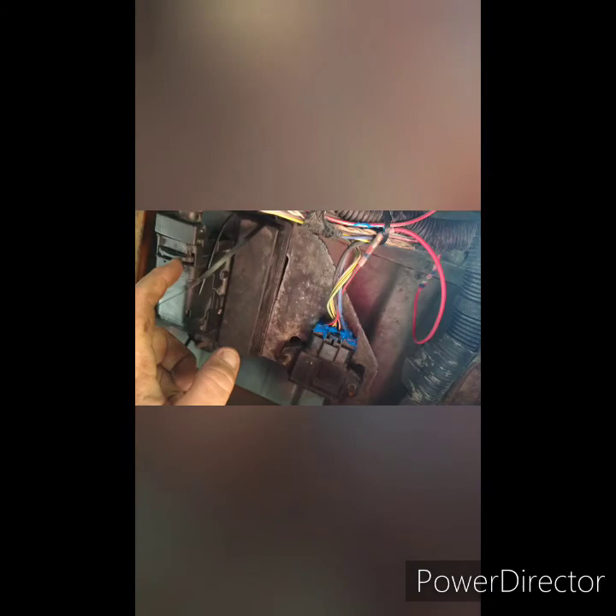I'm hitting the freeze frame — it doesn't have anything. I did an auto scan — it scans all the modules. I went over the wiring diagram. This is the control module, this is the relay — I had it mixed up earlier. Each of these needs 12-volt power and there's a wire that comes back and splices off to them. The red with white stripe only had about 9 volts on it — this one was good at 12 volts. When the guys put in my 5th wheel hitch, they spliced it here. I put some silicone on it with heat shrink solder connectors. The red/white wire was broken in there, so I redid the splice.